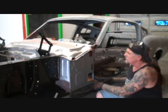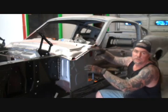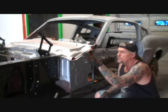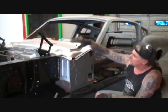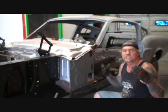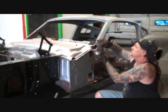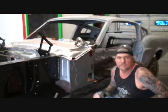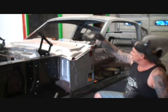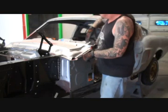What we can do now is go ahead and weld this side panel in here. But before we do all that, we have got to remove this panel here — remember, this was two panels. What we're going to have to do to remove that is put a floor jack in the front to hold our front up, because we've got to remove this brace off of here that's holding that together. It's a domino effect — it's a jigsaw puzzle. It's a ham and cheese sandwich situation: you've got your cheese right here, your ham is over there, your bologna was this piece, and your day-old bread was right here. So now we've got to remove the bolts up there to get our outer cowling off, because we have got to weld the inner cowling to the car before we can go any farther.